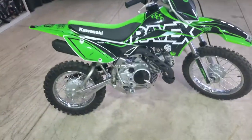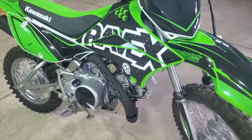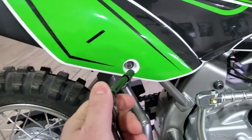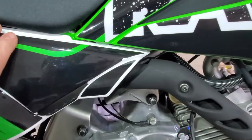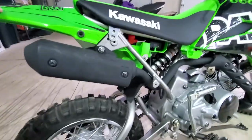First step for putting this on is to take the side panels off so we can access the full exhaust, and that's not too hard. This install wouldn't take very long at all. We'll take that side panel off — just really a few bolts. So just like on the KX 112, we have an 8mm socket here. Just loosen up the screw on the front shroud, and then the front of the rear number plate kind of pops out. That popped right off.